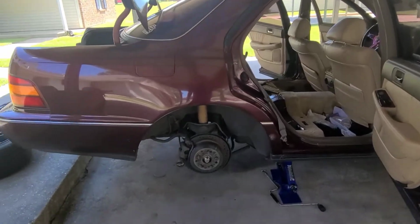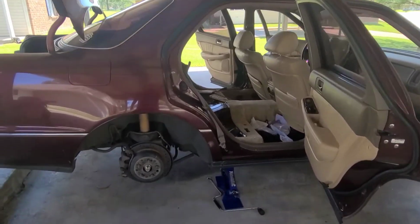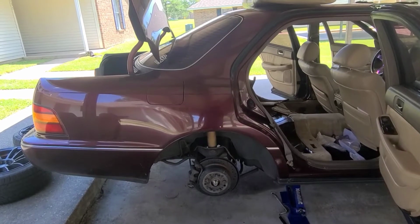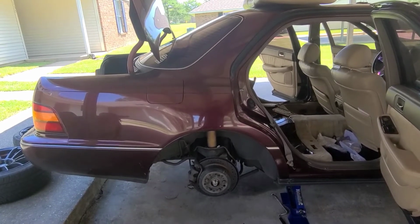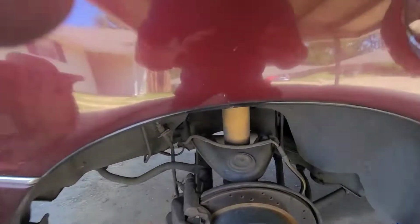But right now we're working on my car, and where we're at. Tires are off. They're back there. Back seats are out. So next process is taking all 4 bolts to get the coilovers out. I'm going to try to loosen up those jam nuts first. But this is what we're planning on doing.